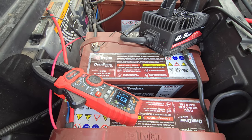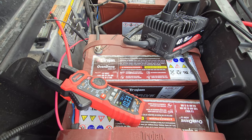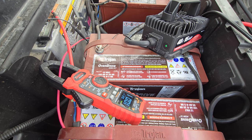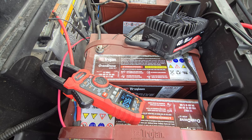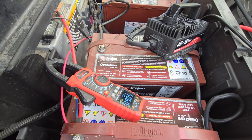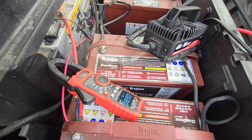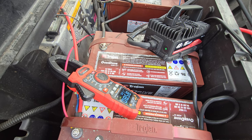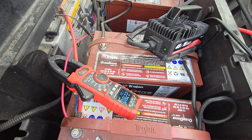The faster it blinks, the closer it is to being full. You can see it's blinking really fast, so it's like 90% charged and up. We're probably not in the bulk stage — we might be in the absorption stage where it charges at a low amperage, or possibly a float stage to keep these batteries topped off. It doesn't need the full 15 amps at this point. When your batteries are dead or close to dead and you plug it in, it's going to bulk up those batteries and send the full 15 amps. You can see the amps getting lower because the batteries are getting closer to topped off.